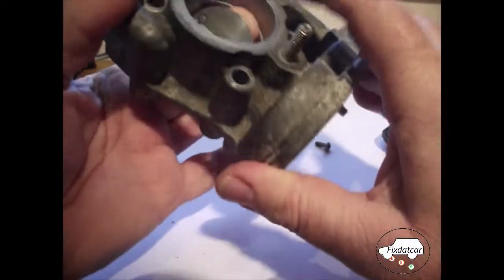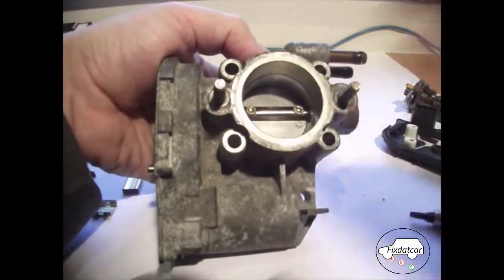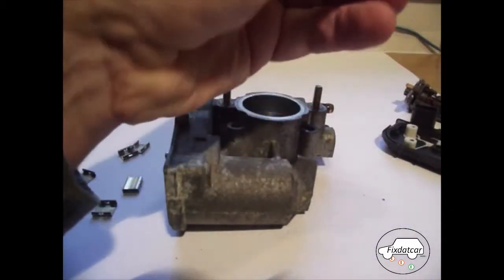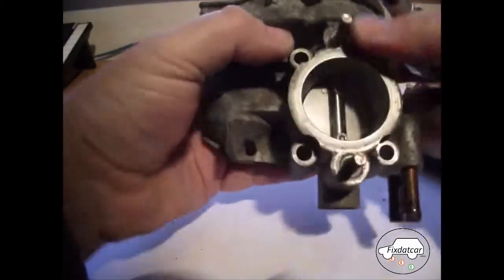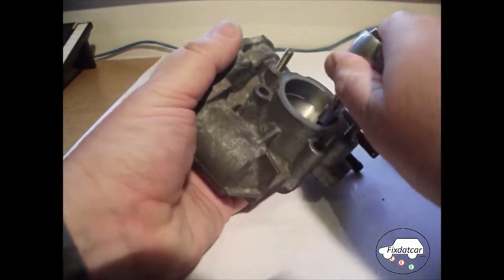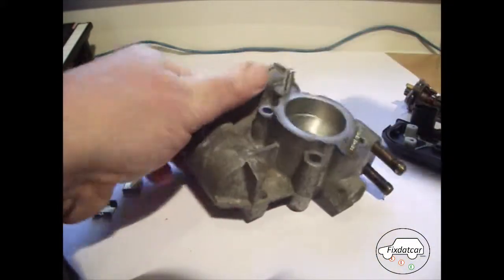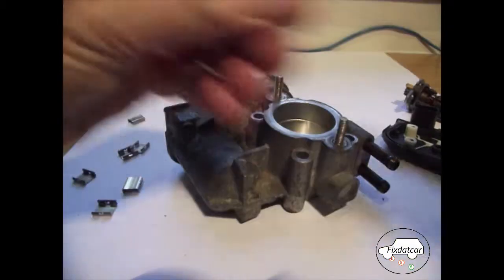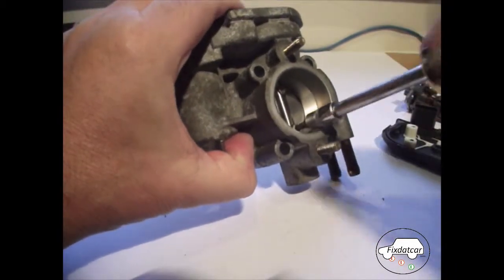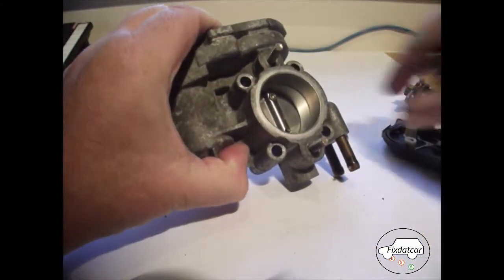So let's turn our attention to this. Once these throttle flaps have been removed, they can be very difficult to get back in the right place. So this is perhaps the last thing that you'll try to take apart. In this case I've cleaned this and I've oiled it, as I suspected that this was jamming. And that didn't work. I'm hoping this will pull out once the flap's out of the way. Unscrew.